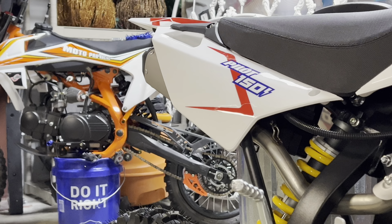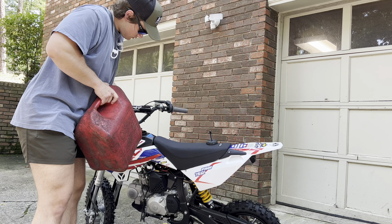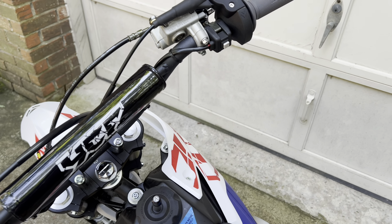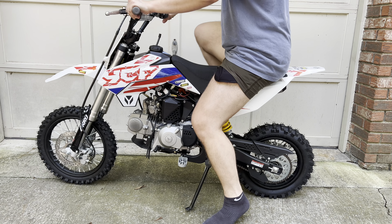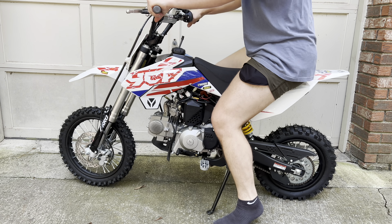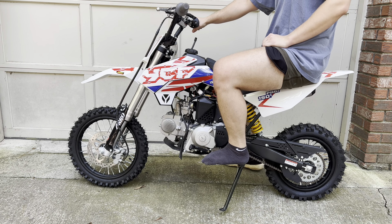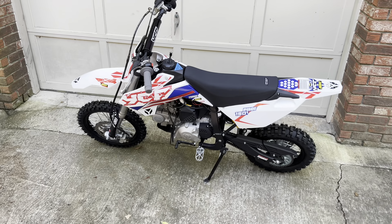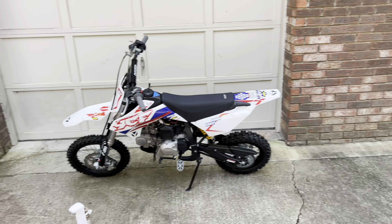I am changing the break-in oil before I start it up. I took an empty quart — it's actually motorcycle oil 10W-40 — so I think that's probably what I'm gonna buy, because I didn't see in the manual what it said to use. It doesn't tell you how much either; it just says to check the level. I'll see how much comes out of it, get a rough idea, and probably just go buy a couple quarts of motorcycle oil for the wet clutch at the auto parts store. I think the battery is dead, so the first start will be a kickstart.